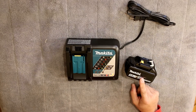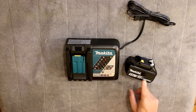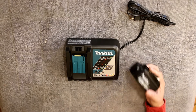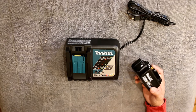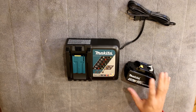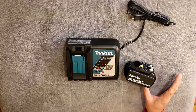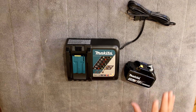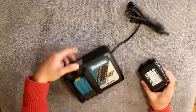Just one thing you have to keep in mind: if you don't use the battery for some time, make sure it's charged. Because like anything else, if you leave the battery dead for a long period of time, it will just have a very short lifespan. If I'm not using one or both of my batteries because I'm on vacation or whatever, I usually charge them and leave them charged. If I'm taking more than a month off, I'll have somebody charge them or I'll come back and charge it again — that's the way you keep your battery's life longer.